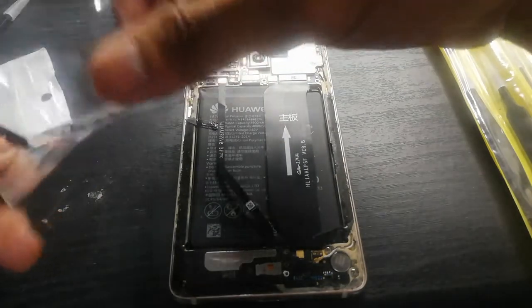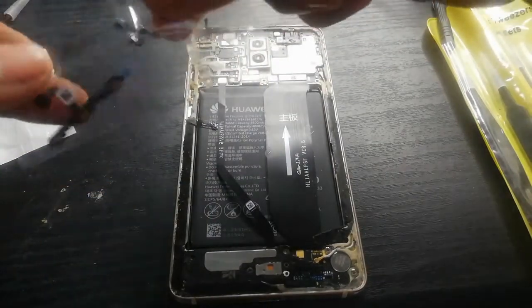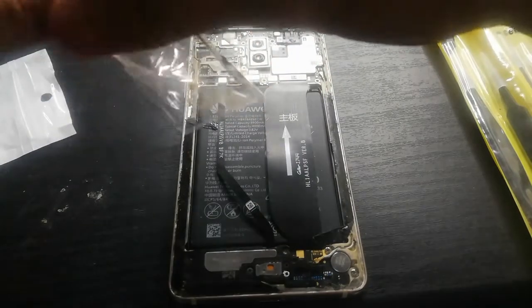This is the day my order arrived, and here is the piece that I need to mount to this phone. For installation of this new button, just like the first time you opened it, disconnect the battery before proceeding. Mount this piece carefully and avoid damaging it.